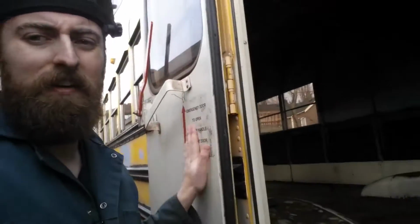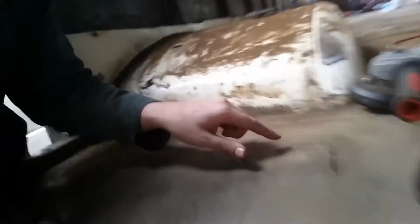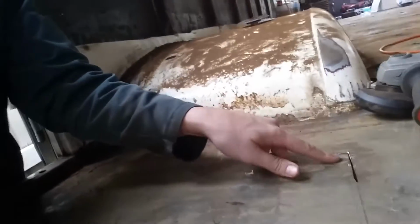All right, I'm working on where the stairs are going to go. I'm standing in the emergency exit right here. Stairs are going to go right here. I started cutting to check my corners to make sure that the edges of where I'm going to be putting it are correct. You can see underneath, that's where they are. It's going to run right next to that mud flap and right inside this little side skirt support thing, and I'm just going to cut through those two beams that are holding up nothing but the floor, so it shouldn't be a problem.